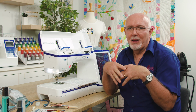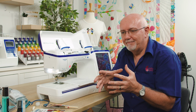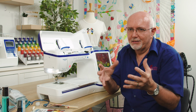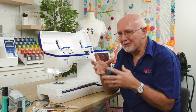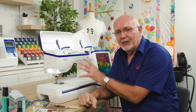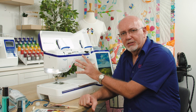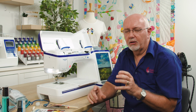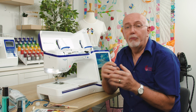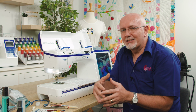The other big one from a general sewing area is, unfortunately, insects, and you have to control that because we live in Queensland, so we understand the issues of cockroaches and other flying little bugs that get in everywhere. They do like to get inside the warm, dark areas of sewing machines. The boards and the circuitry on sewing machines are a real haven for particularly cockroaches. And once they get onto boards and infest a machine, they will destroy a circuit board without any question at all.